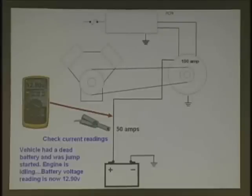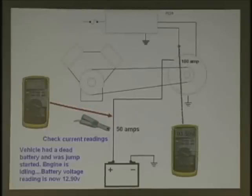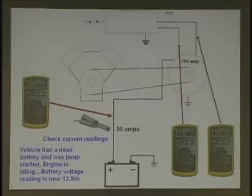Here we go. And again, you notice it says down there to draw some lines. All right. What's this wire up here called going to an alternator? And you're going to see there's going to be two of these now. Rich, do another clip. Yeah. And look at the readings we have now. We got 13.1 volts on this wire. We got 3.5 volts here. We got 13.1 volts over there. All right. What's going on?